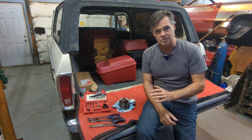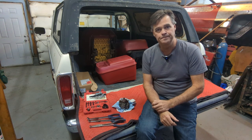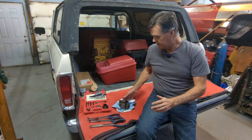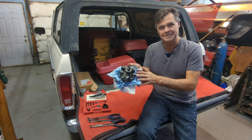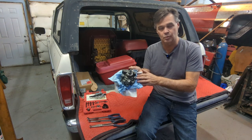I'm not going to make you watch the whole video to give you what you need to know about the part to order for that engine, because this is what we ran into when we were going to replace ours — which part do I buy? You can't find any information about the 2.8 liter engine power steering pump. It's a whole big mystery. I'm going to tell you up front: if you order the pump for the 2.8, it's the exact same pump for the 3 liter, and I believe it fits the 3.6 liter as well.